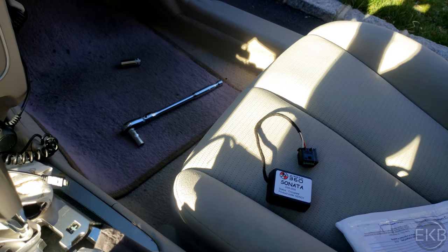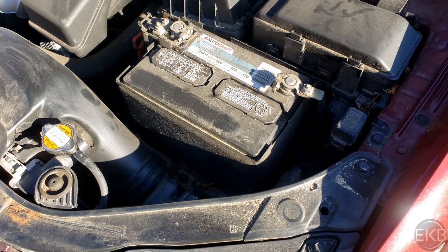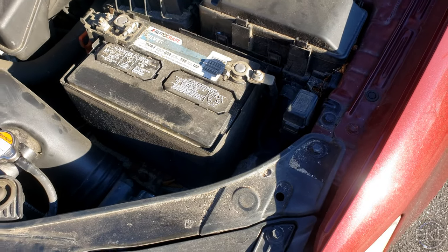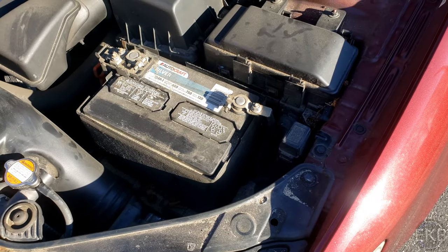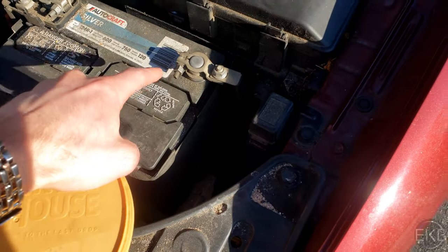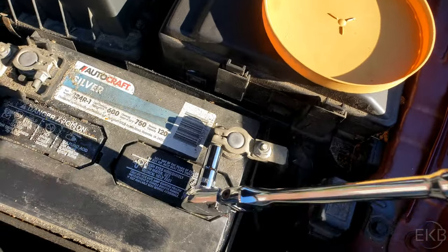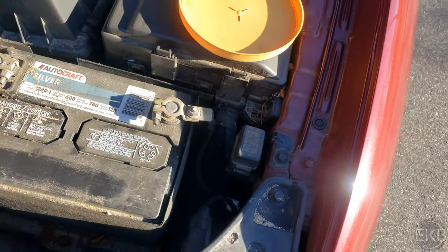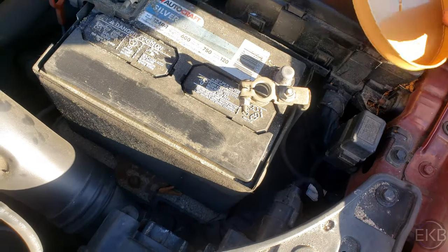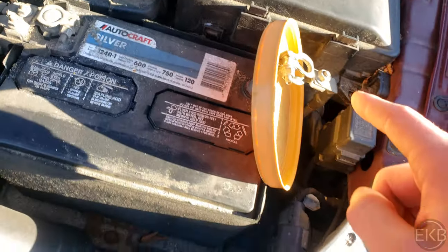Now I'm going to show you how to put it in — it's really not bad at all. The first step is to disconnect the negative terminal of the battery. You're going to disconnect it, wait a few minutes, put it back on, and then if you have an OBD2 scanner, you're going to clear the fault code and see if it comes back. I tried that already and it didn't work for me. So we're just going to disconnect the negative terminal — this is a 10 millimeter nut. Just be careful not to make a connection between the negative terminal and some other metal component of the car, otherwise you're going to create a spark, so just make sure the terminal and the connection do not touch.